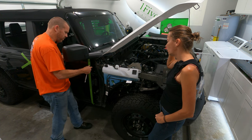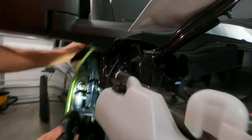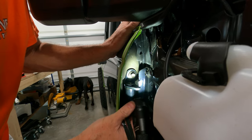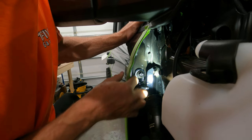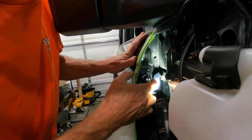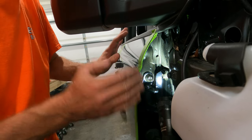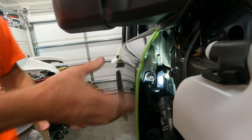So as you can see, you can actually pull this in and out. Okay, so as you can tell, look around the outer edge of that. Now watch the gap — you can move that back and forth. As you can tell right around this bolt you can see kind of a silver spot. You can pull this out, but I can push it back in to align the fender, tighten it up, and right now it has just enough tension to actually keep it in place. So when I do put the fender back on I can adjust it however I need and then tighten it back up once I pull the fender back off.